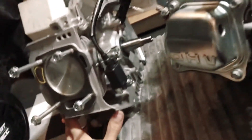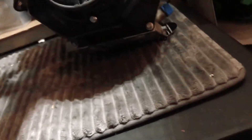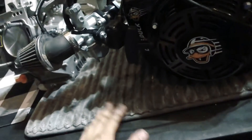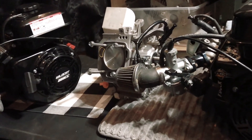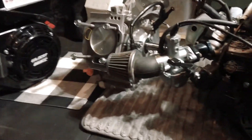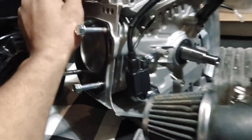This right here is an actual Wildcat block — it comes with a flat-top piston. I noticed a lot of differences between this block and this block here, which is a 212cc. They did just restock a whole bunch of these and I do recommend getting one — it's a very good engine for a minibike. The stock cam is a 196R cam, and it's a pretty decent cam for minibikes.